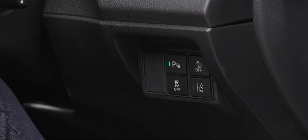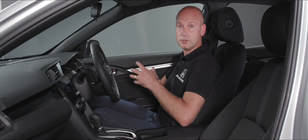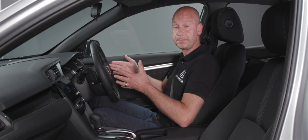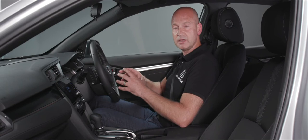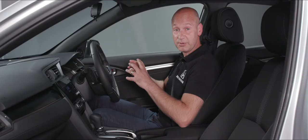Just like parking sensors, when lane departure warning is active there's a little green light to let you know it's operational. It's looking for dotted lines on the road, and if we get a little bit too close to those and the car thinks we're going to cross one without indicating, it can give visual, audible, and even tactile warnings. Road departure mitigation works on solid lines because they could indicate oncoming traffic — more dangerous than crossing a dotted line. In that instance the car can actually apply braking to individual wheels to bring you back into lane.